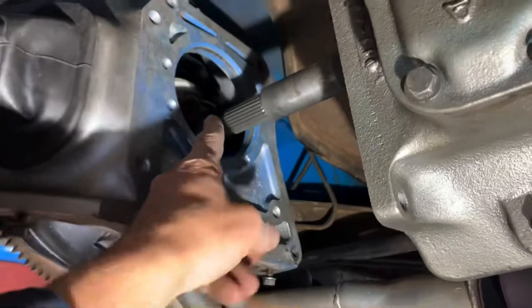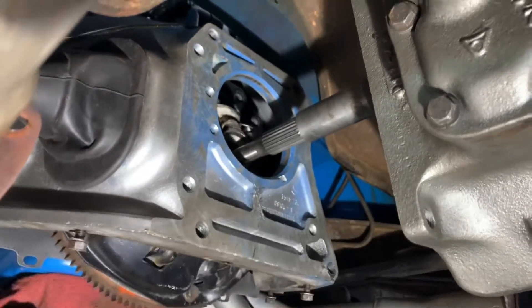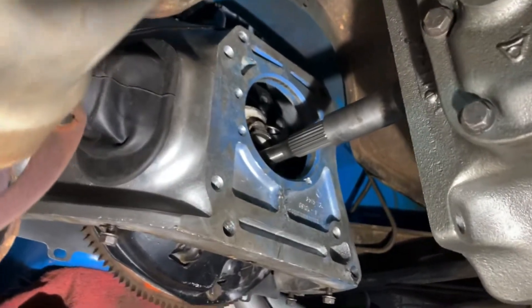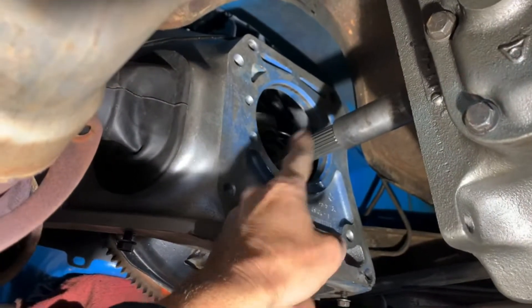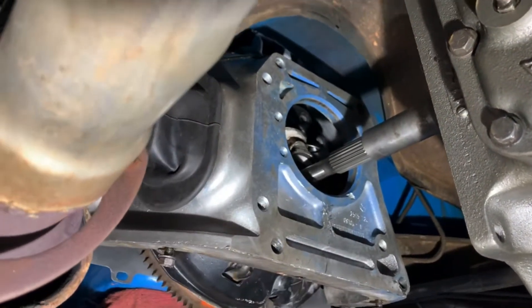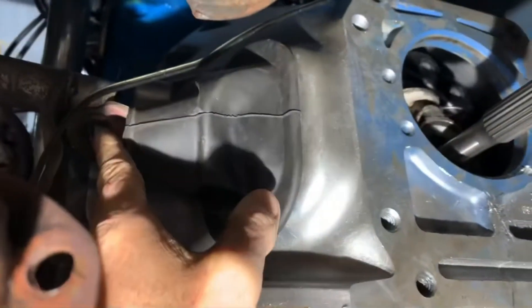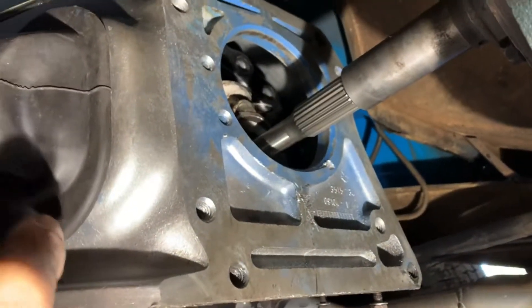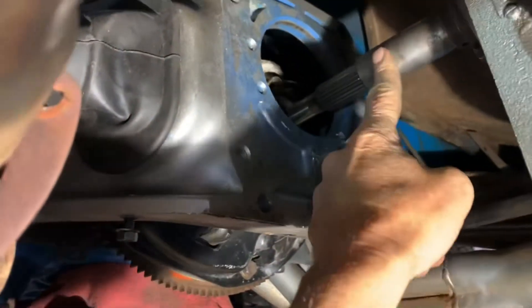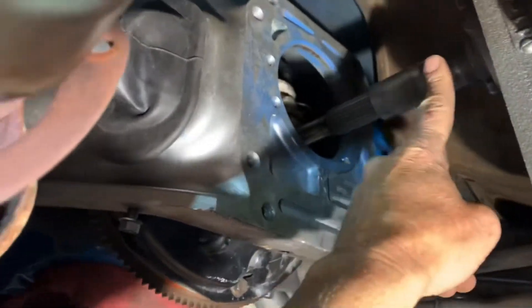Always a good idea to put a little bit of grease on the end before it goes in, and it makes its way into the pilot bushing. Also a little bit of grease here — the throwout bearing rides on that. You can see it moves when you step on the clutch fork. That will move on this housing here, the input shaft bearing housing. There's a bearing in here.